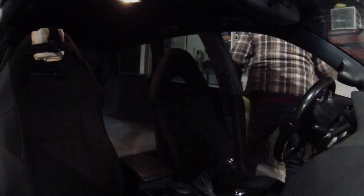This O2 sensor is a spectacular fail. As soon as I got it out on the road, I don't know what it is, but as soon as you make a speck of boost it goes to like 17-to-1. My AFR gauge over here — the wideband — it's showing me I'm in the 11s and 12s at light boost. Right now it says I'm at 16. No good. Piece of crap. Don't buy this brand. That's getting sent back.